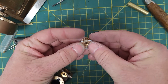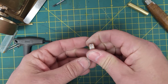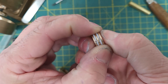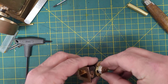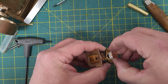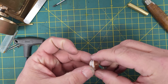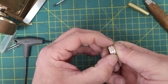And the piston rings fit. There's a very small amount of gap there, which is what you want. I'm not going to try and persuade those in because I need to read up on how to fettle it — may need to make the grooves a little bit deeper. They do measure good; they're both at 50 thou deep, so I'm on spec for the numbers. But the piston rings themselves are actually 53 thou deep, so something has to squish and I need to figure out what.